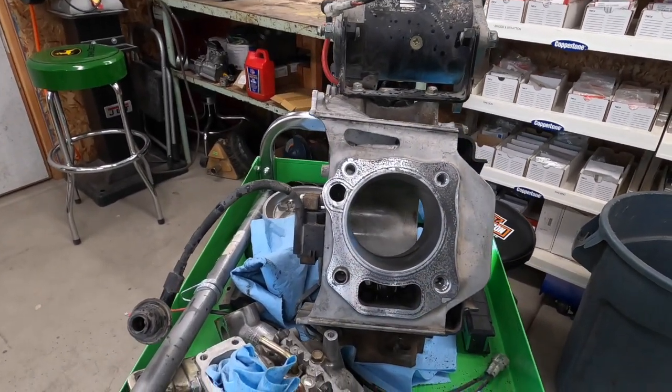That is how you do it. That's how you hone a cylinder. Just make sure you've got the right cylinder hone, the right size. This is the biggest one I've done — typically I've done small lawn mowers and stuff, that's why I had to order the three and a half inch cylinder hone. Just be patient with it, don't rush it. You've kind of got one chance to do it right. Just get the right size, add some oil, and you'll be on your way. If you enjoyed this video, subscribe, hit that thumbs up for me. If you have any questions, leave them in the comments down below. And as always, make a choice to have a great day. Thank you all for watching — we'll see you next time.